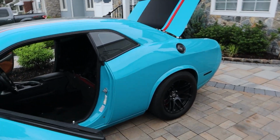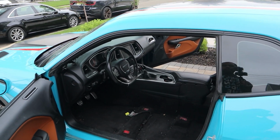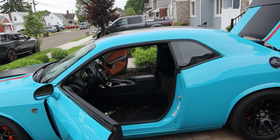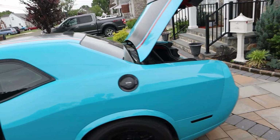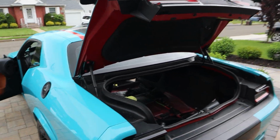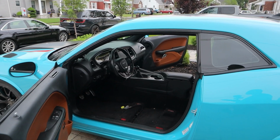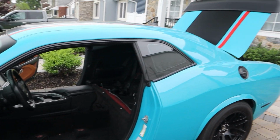Now, Stefan, you can't drive the car like this. There's no driver's seat. So what the hell are you gonna do? Well, guys, I ordered a Kirky seat. What the hell is a Kirky? A Kirky is about a 13-pound metal seat. It is SFI approved, meaning that it is approved for drag racing. And also I ordered a planted seat bracket, which that Kirky seat is gonna go on. My assumption is that I'll be adding back about 30 pounds with the seat, the bracket, and the hardware.